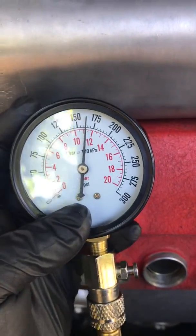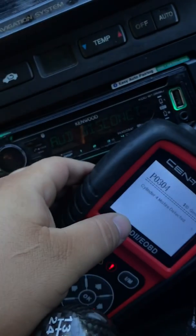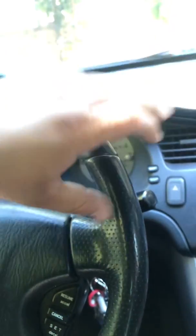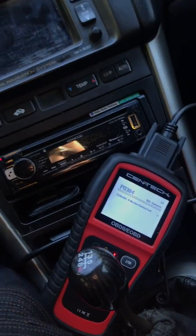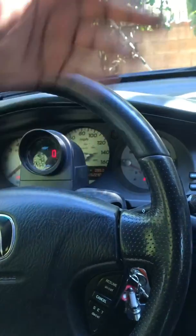Moment of truth — cylinder four compression went up more than 125. We did a compression test 108 miles later. Cylinder number four is still misfiring and the check engine light is on, however we did get an increase of 45 PSI. It tested at 120 PSI originally, went up to 125 at the first six miles, and kept going up — 108 miles later we got an increase of 45 PSI total. I'm really happy with the results. Engine Restore is a good solution for people who don't have a lot of money.